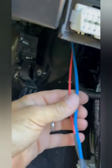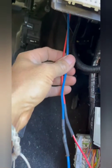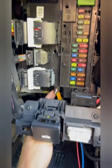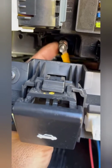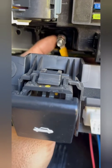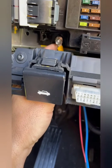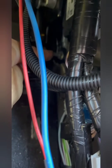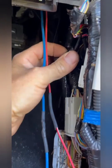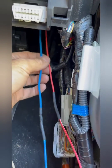Here is the wiring on the four-pin plug that plugs into the control unit. The earth I've already done — I've done it at the fuse box where there's an earth stud. There's already a nut there that holds the plastic on. I like to put my earth point over the top of that nut and then add another nut — a 10mm nylock nut so it won't come loose. There is also an earth point there as well, entirely up to you. The power cable join is already done and it's going to be cable tied up with more conduit.